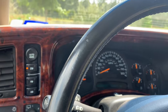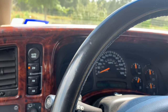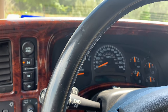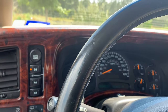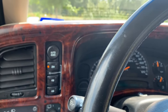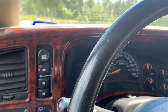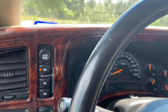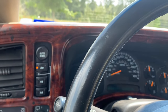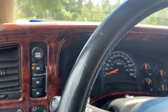When you plug the battery back in it resets everything. What I did was disconnect the battery, put the transfer case control module in, then immediately put the battery back on and started it up — and I had the same issue: no lights. I was frustrated. I had just dropped $220, followed the steps, got the code read, and it still wasn't working. I disconnected the battery and walked away, because I didn't want to just keep throwing money at it — a new switch, the TCCM, the transfer case shift motor.